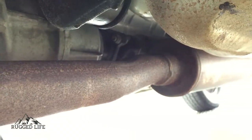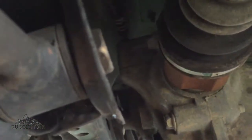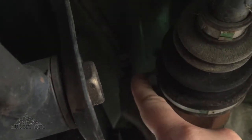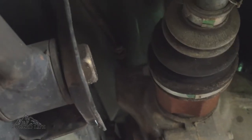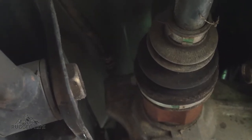On to the back of the vehicle — it's way easier to access and find the differential breather. That's your differential CV and, just above there, is your differential breather. Remove the original hose and take it with you to Supercheap or your local auto parts store to get the right size.